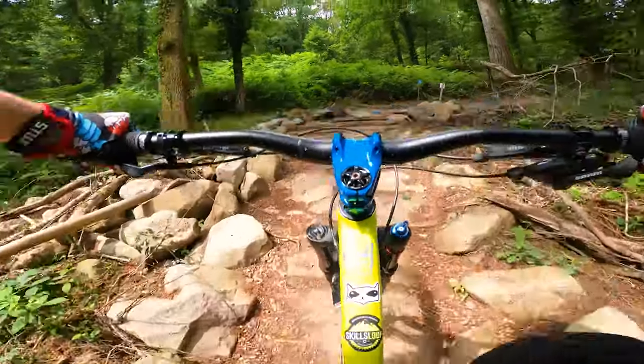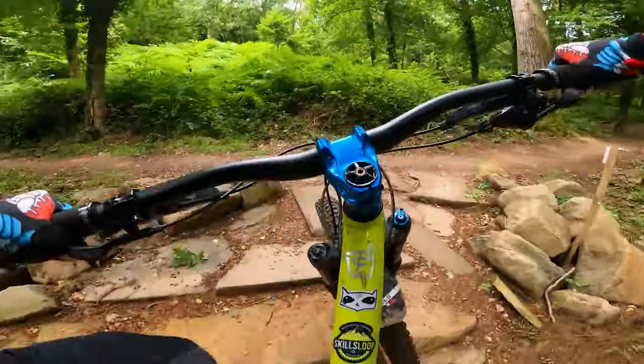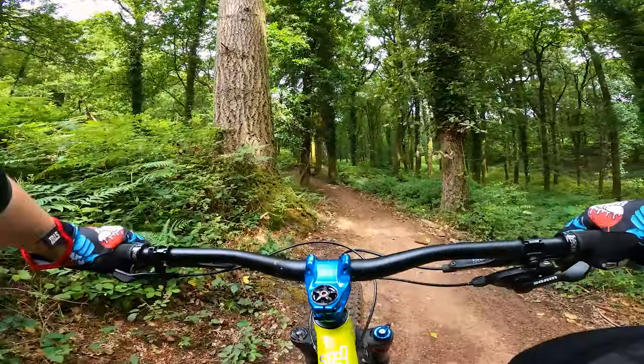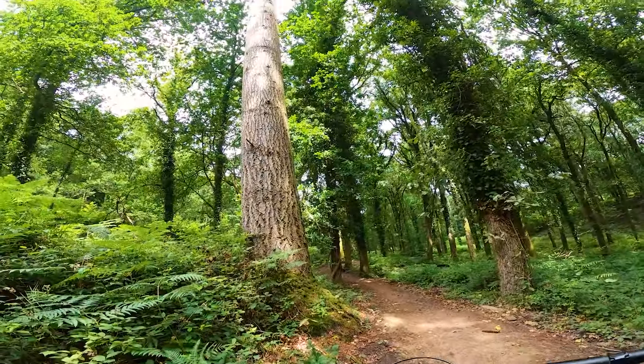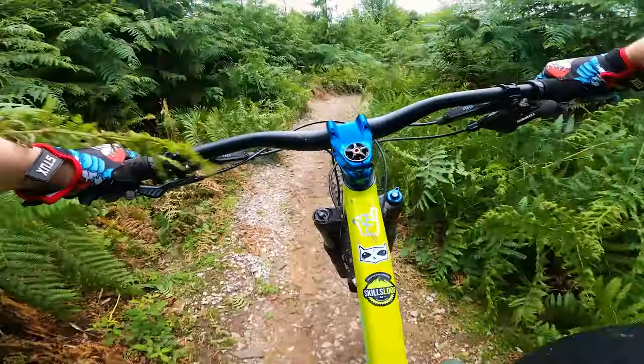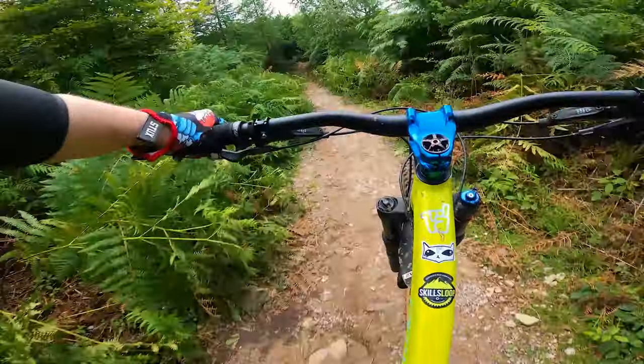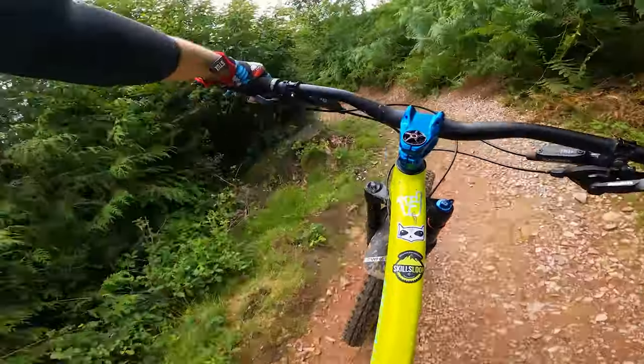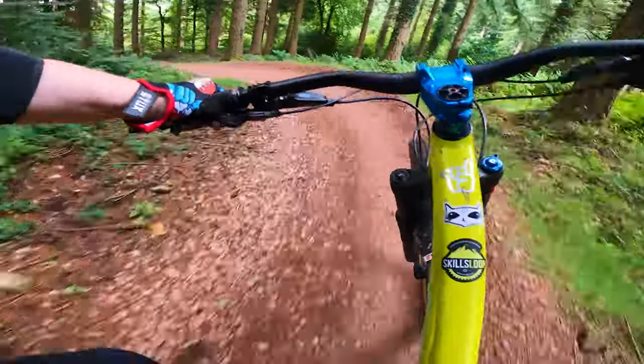Sarah opted for a 12-speed SRAM NX groupset, keeping the same chainring size, but adding more to the rear to help with climbing. Whereas I went for a 12-speed SRAM GX groupset, increasing both front chainring and rear cassette sizes to keep the same climbing ratio but add more speed. And of course, we both added a bit of Burgtec bling.